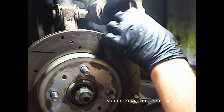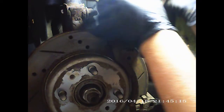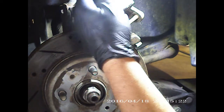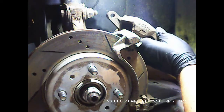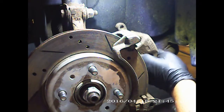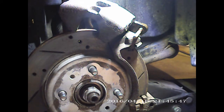Let's see if we can break this sucker out of here. Oh my god — I'm gonna have to put some PB Blaster up on there to get that thing loose. Let's unhang it real quick, throw it over this way, away from everything. I've got some brake cleaner for that rotor anyway. I'm gonna let this sit, brake clean that rotor, and we're gonna let this sit for a minute and see if it'll soak in. If not, might end up trying to heat it up with a torch.